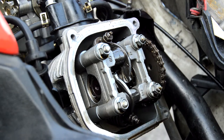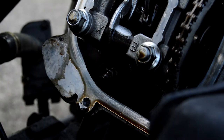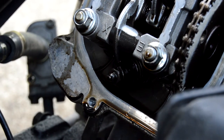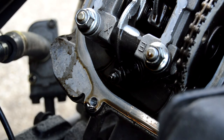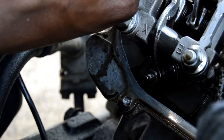Got a little knocking right there. You want to do the same thing for the bottom — just for the sake of the video I'll show you the bottom part too. I usually set it at either 0.005 or 0.004 — that's four or five thousandths of an inch. I'm probably going to set this somewhere around four or five.